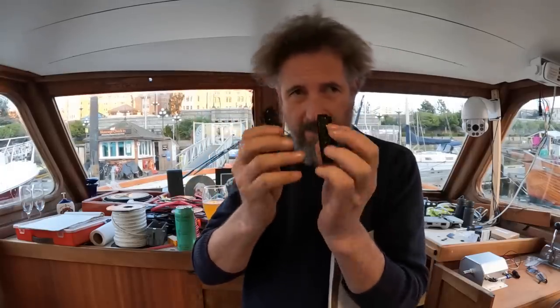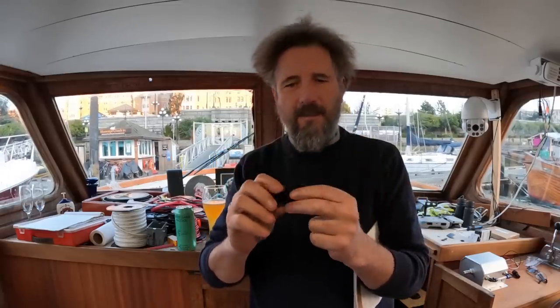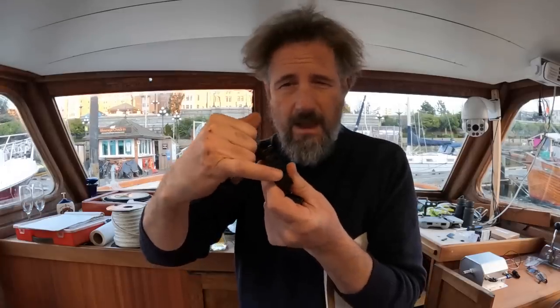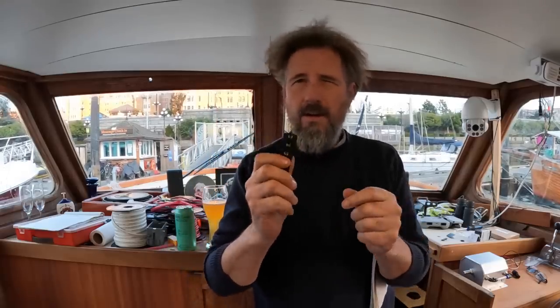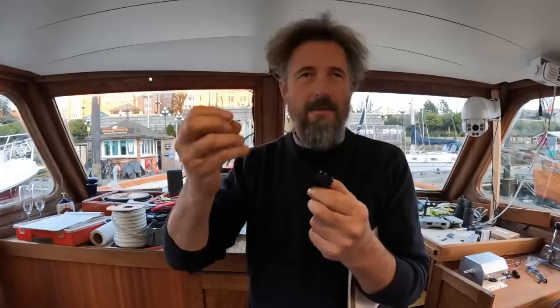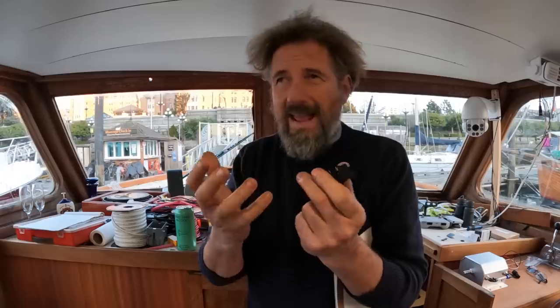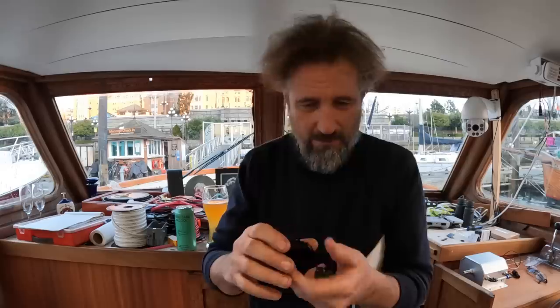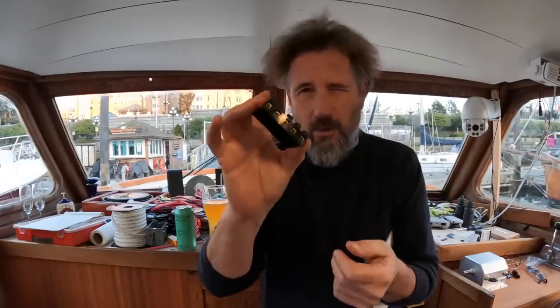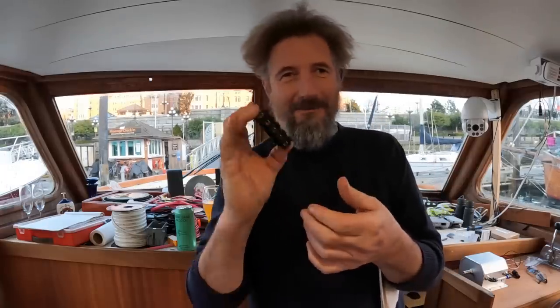And I'm gonna use the pair of these actually in some rewiring I'm doing on my Land Rover. And I think it's gonna be perfectly appropriate for that. I'm actually gonna fill these little screw terminal blocks with silicone grease first, dielectric grease, put the wire in and clamp them down. It's a type of wiring that in the past I would have been hesitant to use because I would rather put a full terminal on a wire and put it on a regular terminal strip and everything. But this is no less exposed to the environment than that is, unless you cake the whole thing or pot it somehow. So having found really good ones, and to be fair, they're not cheap, so thank you very much, Patrick. I've gone on about these a bit too long, but I really like them.